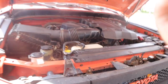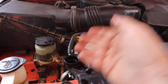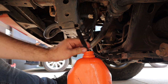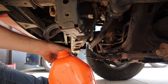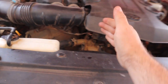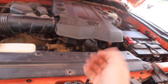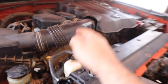As your coolant drains, it's going to build pressure in the system, so make sure you take off your cap so that pressure doesn't build and your coolant can continue to drain out. Once our coolant is completely drained with nothing more coming out, we can remove the tube — it'll still be dripping for a while so leave the pan underneath. This will drain all of the coolant that's in the radiator, but because our engine is cold the ports that access the engine are closed off — our thermostat is closed. So there's a lot of coolant in the engine that we won't be able to get out by just draining the radiator.